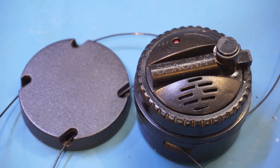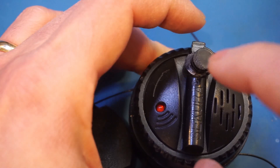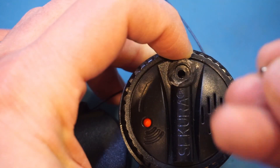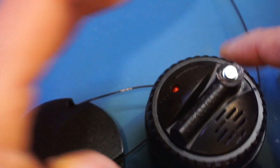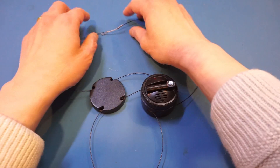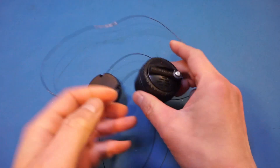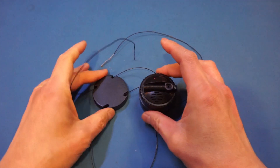As you have already seen in the demo video, to lock the device in place you just press this button, and there's a pin mechanism that actually drops into place to lock the lever. I have already cut out the top, but you can see there's a hole inside — that's where this pin drops into. So let me manually place the pin in here to lock the button in place. Now the device is armed. Once the device is armed, if you cut the cable you will hear the alarm sound, and once the alarm is triggered you cannot disable it by reconnecting the wire. The only way you can stop it is to remove the pin and reset the switch, and now the alarm is disabled.